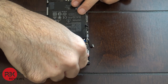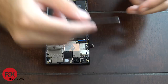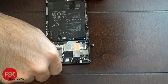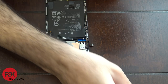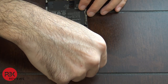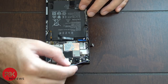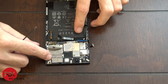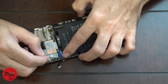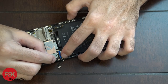You have one screw by the loudspeaker, between the loudspeaker and the front-facing camera. Then put the two silver Phillips screws back in — one on the top right that holds down the camera cover, and the smaller silver Phillips screw on the top left that goes over the gold contact. Next connect the thin black wire back onto the board in the corner — these are either Wi-Fi or antenna wires.